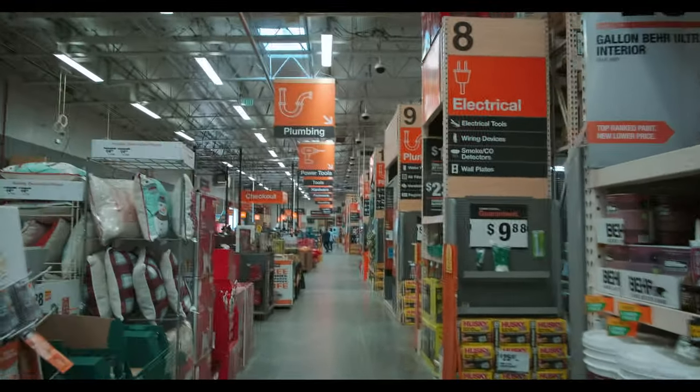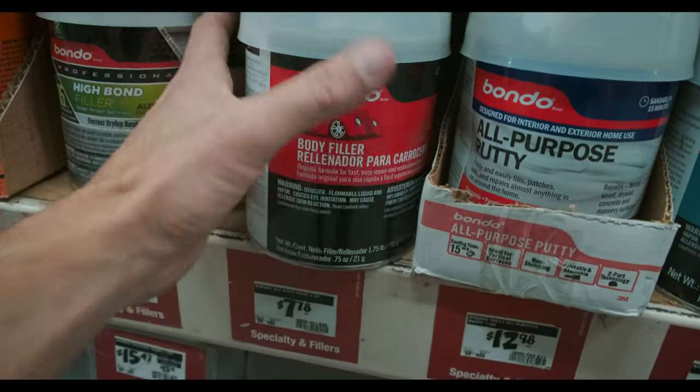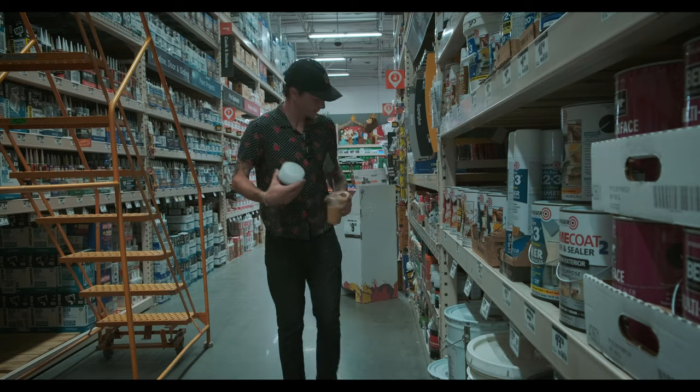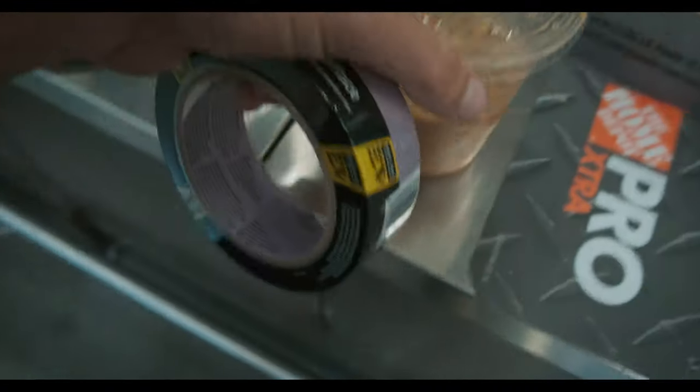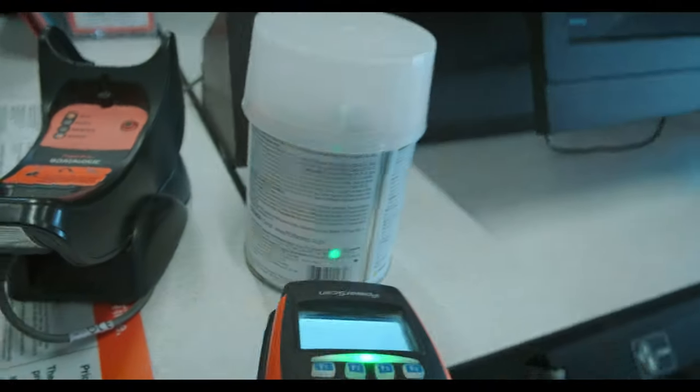The things we're going to need at Home Depot: first is Bondo. You'll find Bondo in the paint section, and it always comes with the hardener. I always try to grab a couple of the free paint stir sticks because those are really helpful when using Bondo. Tape is also a must. You definitely need some tape, and also a tray to mix in is really good to have, along with a Bondo spreader — a plastic scoop or spreading tool. If you don't have the money for that, you can use a cardboard box or anything you can basically scrape the Bondo with.